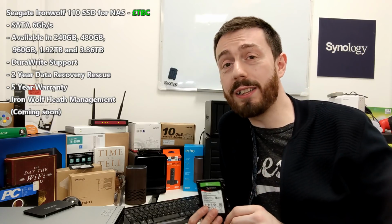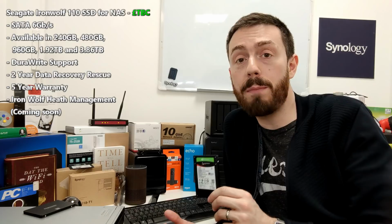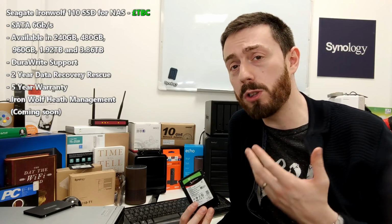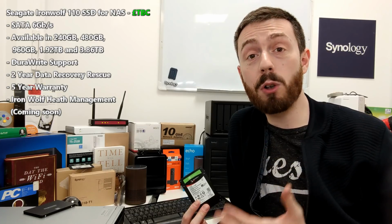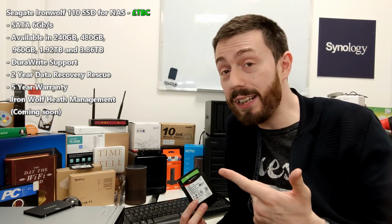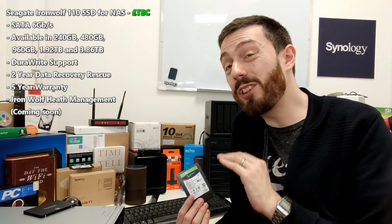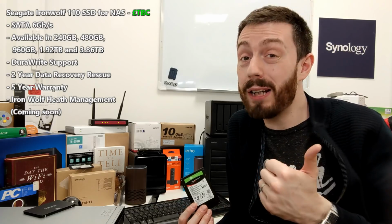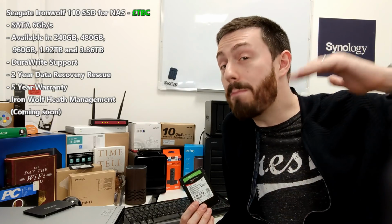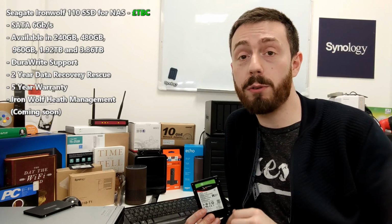That is an enormously big difference there. That's why a 240 gig SSD costs so much, because of the NAND chips. It doesn't have moving parts, it's a more specialist constructed piece of equipment, and the prices are respective of that. The speeds are faster, there's a much lower electricity consumption, and of course less degradation on the drive. But hard drives, you get bigger sizes for much, much less money. In fact, some SSDs can't even match some of the 14 or even 16 terabyte hard drives we're seeing at the moment.